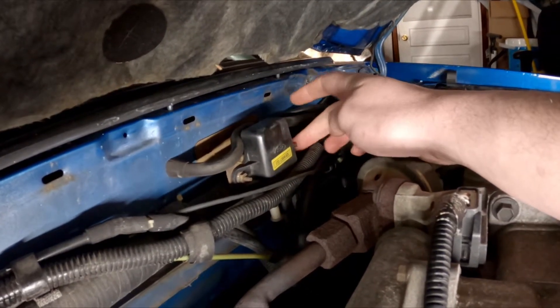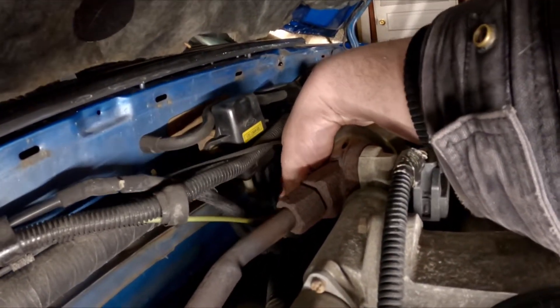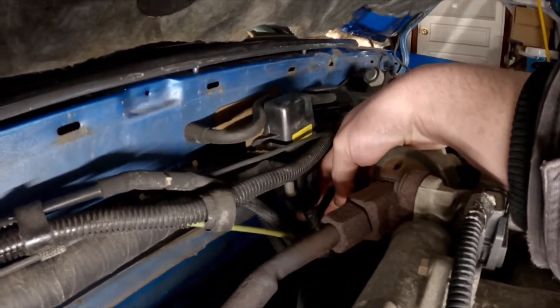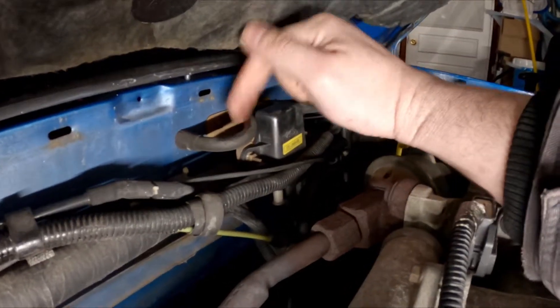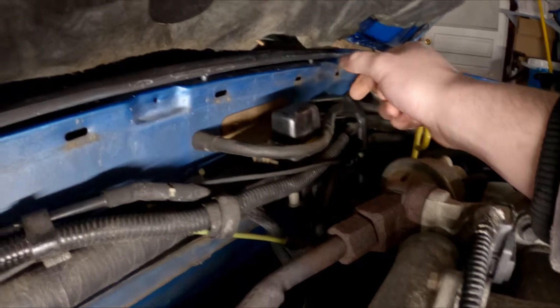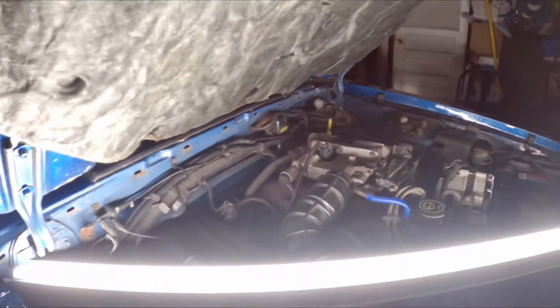The only things I need to use are these three wires right here. You've got your 12-volt signal which is your red, your ground is black, and then your signal wire — the yellow one — goes to the MicroSquirt. That's pretty much all of the wiring there. The only things left to do under the engine bay are to mount the GM MAP sensor and repin the connector with the supply connector that's going to work with the GM sensor. I also have to install the O2 sensor under the car. We're on the home stretch here.